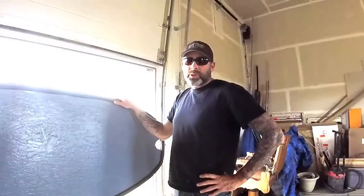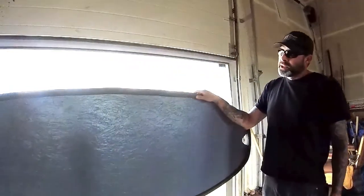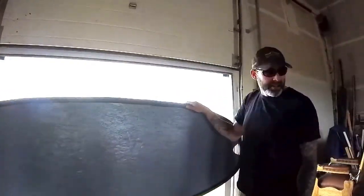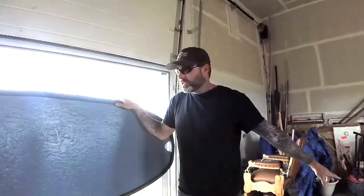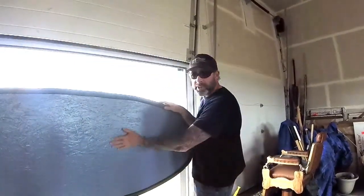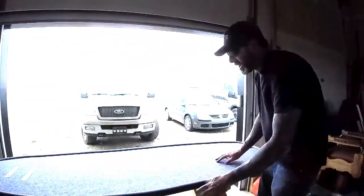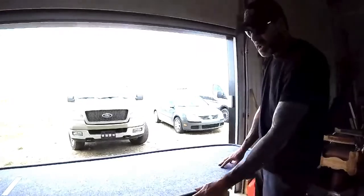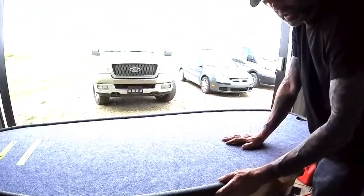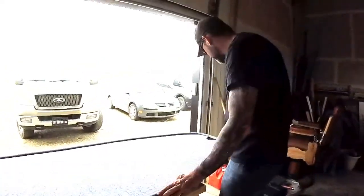All right, so I wanted to get a sturdy floorboard for my boat here, so we got a piece of plywood, and I cut a template off the bottom of the boat using a piece of clear poly, and then I went ahead and primed it, gave it several coats of a nice semi-gloss paint, to give it a nice smooth surface, and then on top we went ahead and got an outdoor carpet, glued it down, and finished off the edges with a 1/2 inch copper pipe insulation, and we just silicone that in.